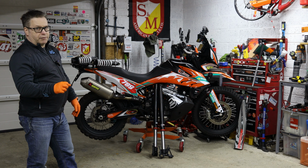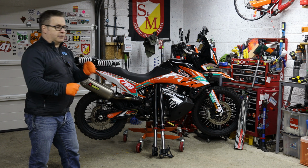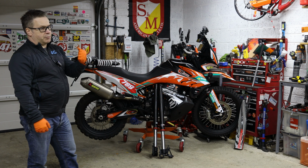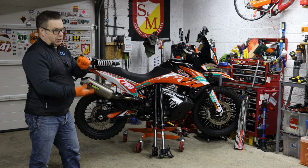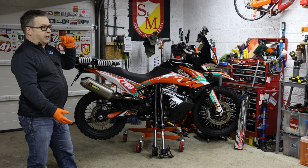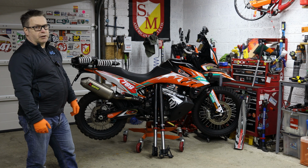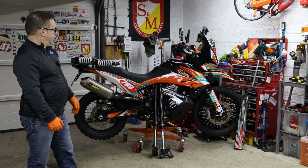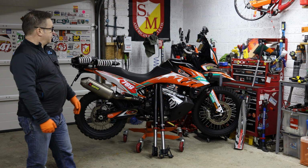It's got a really good platform on braking on the road and off-road. If you pull the brake, there's very little dive. It seems to just nicely firm up on you, especially with the compression as well. There is no high speed, low speed, it's just compression, so it's just whatever it ramps up at. It does seem to take the hits quite well, so I've hit some choppy stuff fairly fast and it works well. So I'm really pleased with the way the cartridges have turned out, and to be honest, the forks have been faultless since I got them done.